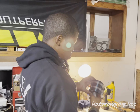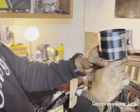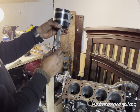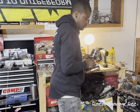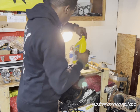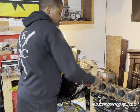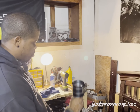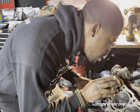Make sure the skirt of the piston is completely out — this is how we're going to get it down into the bore. Make sure your piston is facing forwards and all your rings are clocked and ready to go. Match up your connecting rod end cap to make sure it's the right one. I like to put a little bit of oil in the bore — just a light dab — then slide the piston down into number one cylinder with the piston facing forwards.